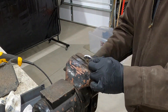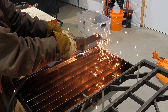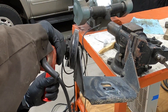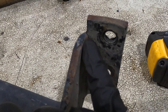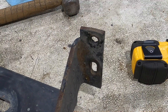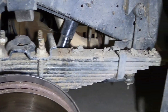I'm gonna knock it down here a little bit. That's the side that's broke, and on the opposite side I notice there's a little crack — so I'm gonna clean that up and probably weld that too before it gets any worse. Slight change of plans — since I'm this far in, I think I'm gonna add some two-inch lift blocks, because this thing's already sagging. The spring's pretty beat up.